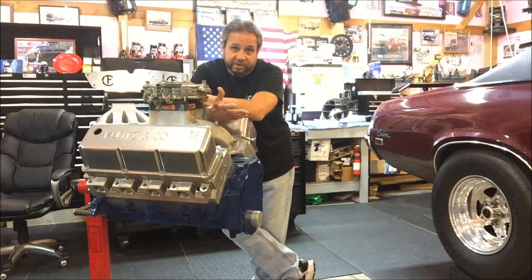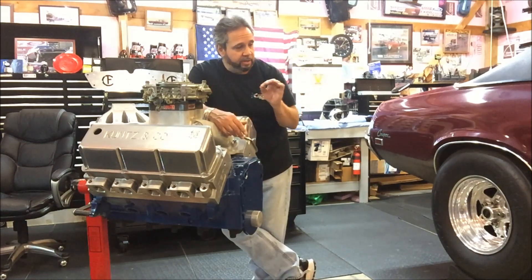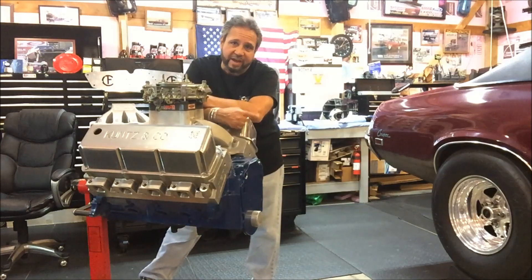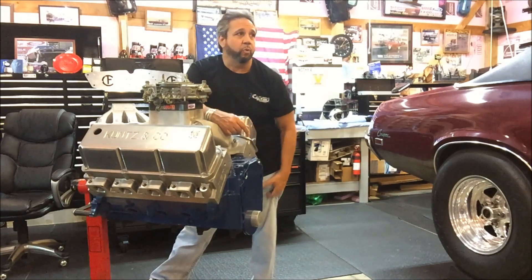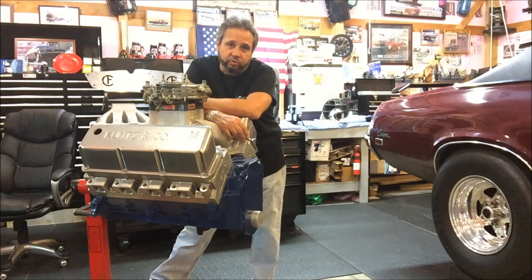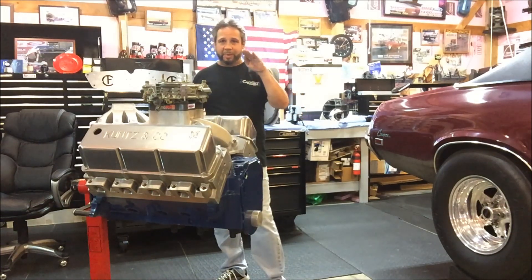I'm just going to do it simple. We'll videotape it, you'll see the gauges, and we'll make a determination if we're going to change it. Pinion angle — the relation to the drive shaft — is adjusted with shims underneath the leaf springs and the mount. They come in two and four degrees. I did run four before, but when I had it with this rear end, the new fab nine inch from Quick Performance, it was measuring like eight-something. That's why I went back to two. We want to be within four to seven degrees negative because under load, when you're nailing it in the power, that pinion wants to rise up. So under power it's almost zero degrees, which reduces load and friction. Tim Meyer took a Spicer driveline course and said those roller bearings actually need a degree of flexion — positive or negative — so they don't burn out.